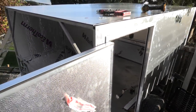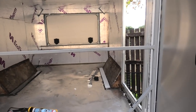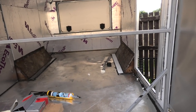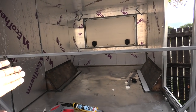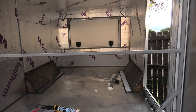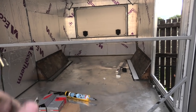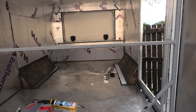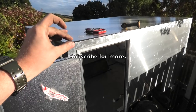The door's in there with it all interlocked out. What we're going to do next is paint these two arches because these are new. Then from there we're going to get some plywood — plywood the ceiling, plywood that end wall, insulate that arch and that arch, plywood that wall. Then we're going to get the floor in. Once that's done we'll cut all the pieces, chuck them all in, put this end wall on and then fit them back to it. And then pretty much we're sealed — all that's left to do is go round and put the trim on everywhere.